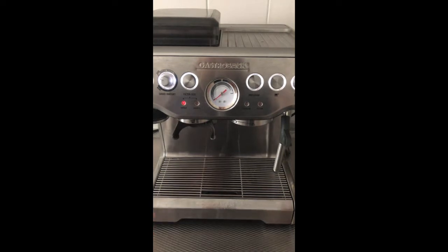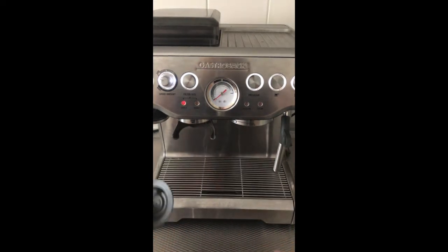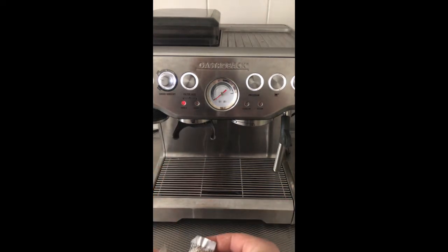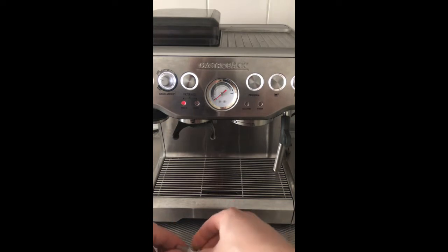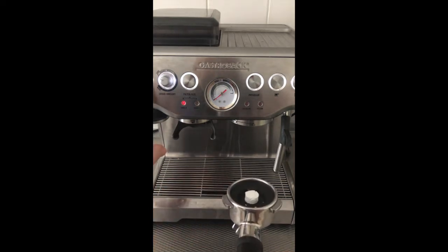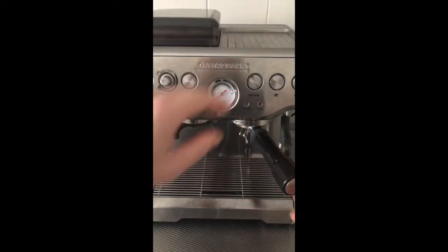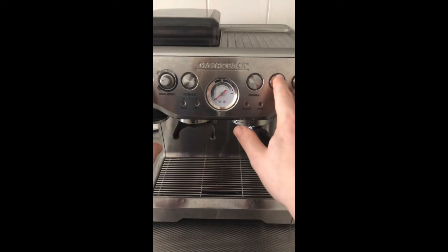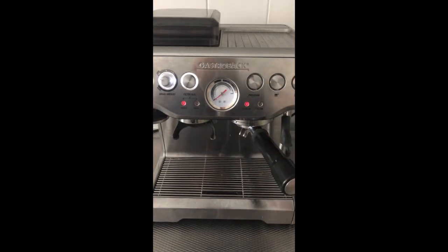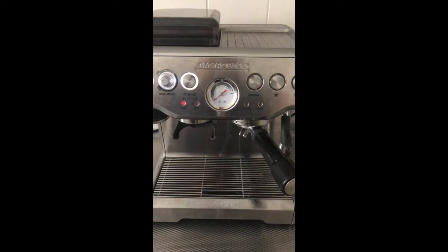Put that aside and take out the rubber cover. If you don't have one, you can easily buy it in any store, especially online — Breville is also selling them. Cut it open, put the tablet in the center just like this, then turn off your machine. Put it into position, tighten it up, then push these two buttons simultaneously. Now it's going to clean up the group head and the boiler on top. This will take five minutes.